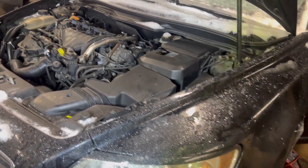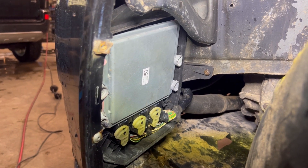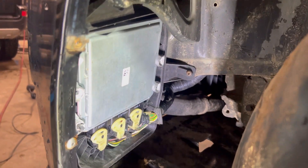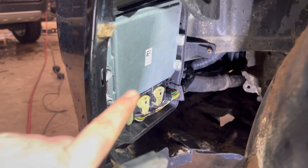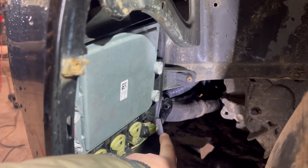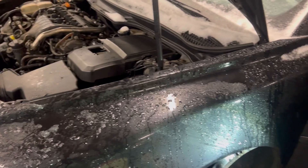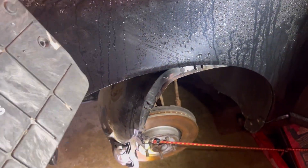Normally on a Volvo V50 you probably already know the engine electronic control unit is located in not the best place — where the mudguard is. The box is plastic, it can be damaged, it can be broken. This one is already replaced. It's a V50 two-liter engine — it's been crashed, water is coming in, and as you can see it's already leaking from the top. The seal is not the best. This is a very bad place for an electronic control unit. So before you want to buy a Volvo V50, think about where the ECU is — because there will probably be problems with it.